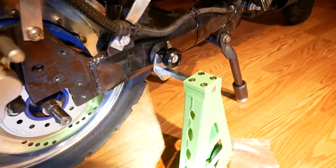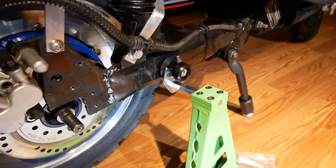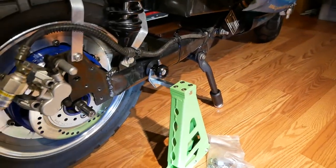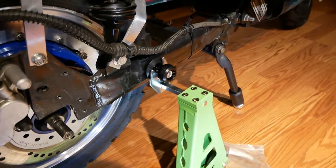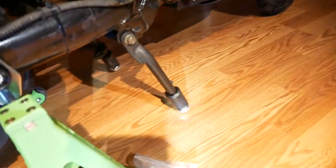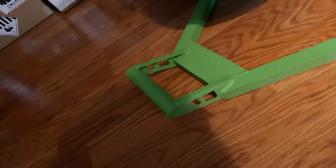Another little detail I did: these are motorcycle swing arm spools, so you can use one of those swing arm jacks. I found out about these things existing not so very long ago — two months ago or so — and went, 'oh damn, why don't I have one of those?' So I bought a set of spools. One of those jacks wasn't very much money — about 90 bucks — and the spools were like $25. There's an M10 by 1.5 bolt that goes all the way through the swing arm. There's a rivnut on this side, and on the back side there is a nut, so it's well supported. It's way easier to use, and way more wood-floor friendly.